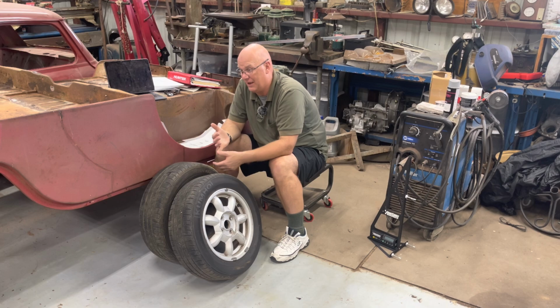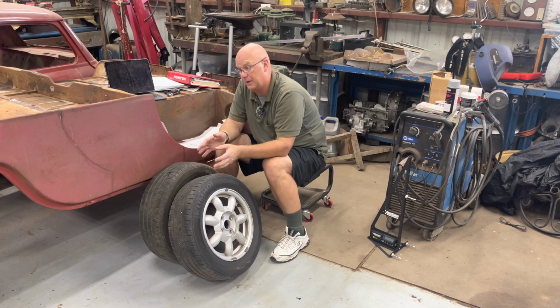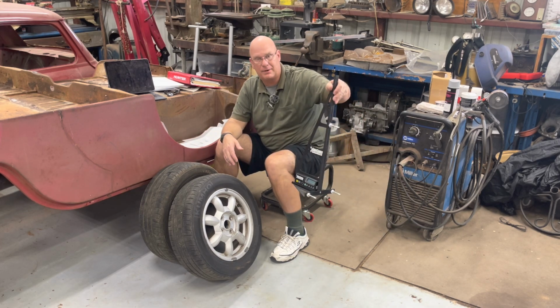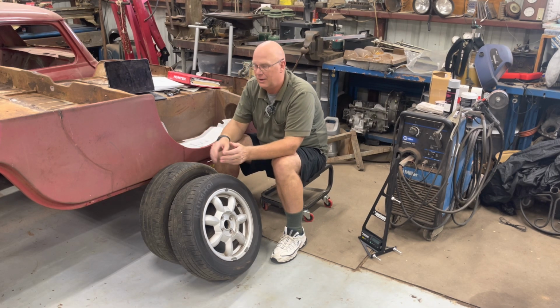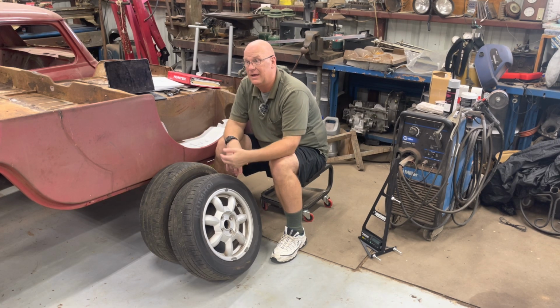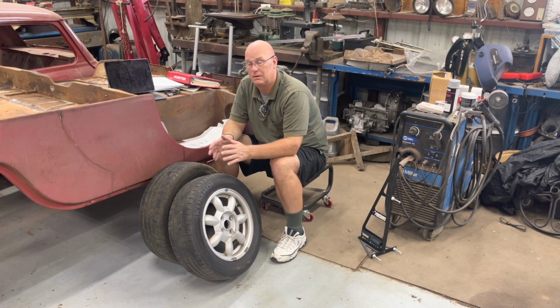And yes, I think I'm going to end up saving money in the end, learning to have the equipment. Yes, I spent close to $1,200 total on all the stuff from Smart Racing Products, the fancy camber gauge and the camber holder and the strings and the fishing reels and all that kind of stuff. Yeah, it gets expensive. But if I do 3 or 4 alignments, then I'm breaking even. And I know my vehicle. I know it's set right. And I can sit in the car, have somebody else do measurements, or put weights in the car if I wanted to. I can get it exactly right for me.